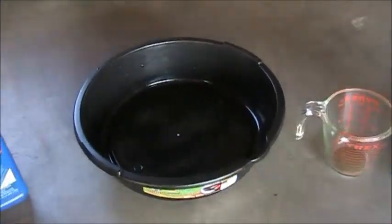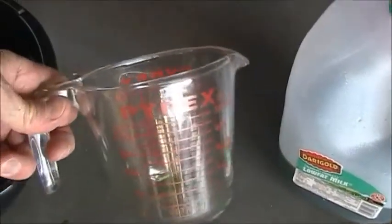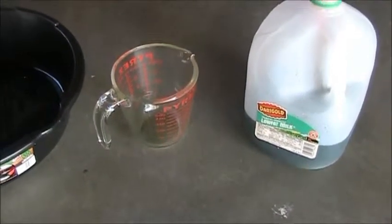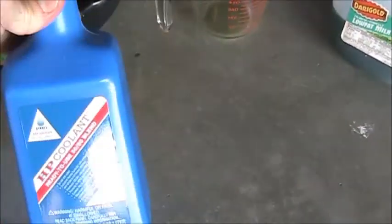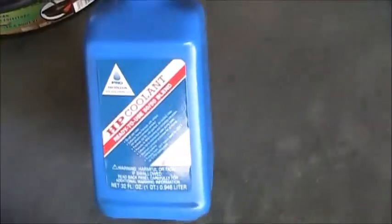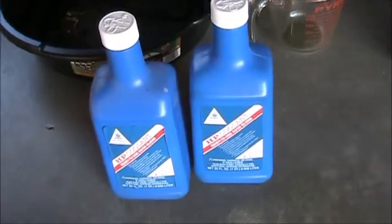When I finished draining the fluid into the catch pan, Bill wanted to know how much actually comes out of the bike versus what the maintenance manual says. I was very careful pouring it off into a measuring cup and then into an old milk carton to take to the recycling place. In the end: 1.4 liters came out of the EX250. I've got Honda HP coolant here — a 50/50 mix, the same green color as what came out from the factory. One and a half of these just-under-one-liter bottles should go back in.